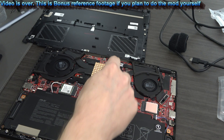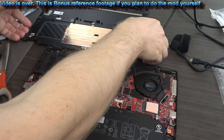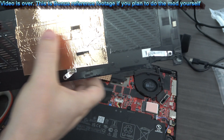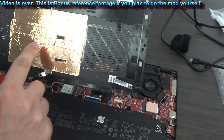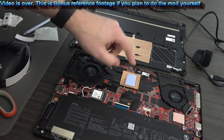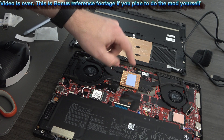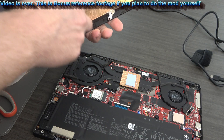What you may want to do — and what I probably should have done — is drill out some holes so you can still remove the screws underneath here, but that's fine for now. I've got all the copper foil down. This is very sticky — you want this to stay down. You would not want copper foil coming loose and touching components in here, so make sure you do a good job getting these into place. I'm using a very thin pad here — just want to get a little bit of heat transfer. I still need this to close and seal against the top, so hopefully this heat pad is not too thick. I think it's probably going to be just about perfect. We'll get this closed up and see how it goes.